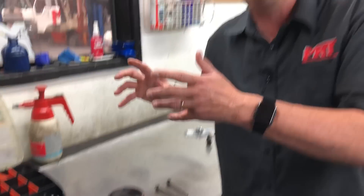It's important to point out that this doesn't mean Subaru makes bad pistons. Every car made by every manufacturer in the world has its strengths and weaknesses. Take the 2-litre FA series engine in the current model WRX and Forester — the pistons are reasonably good in those, but the rods are the weakness and they bend under certain boost levels and load points. It doesn't mean it's a bad quality rod; it just means every engine has a weakness depending on how you extend the performance and the grunt you're chasing out of it.